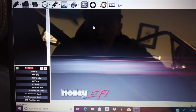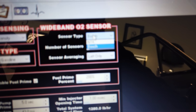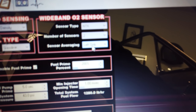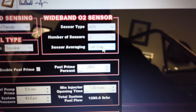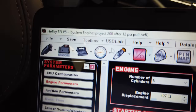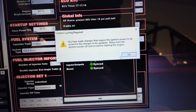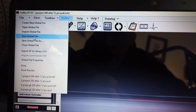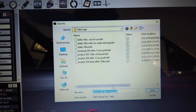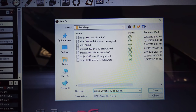So I went ahead and downloaded the tune from the car. I'm going to go over here to configuration — select Bosch, put it to NTK 2. I'm going to go ahead and leave it on left only for right now until we see what the right bank is doing. I ended up going to left only because that other sensor was fighting us for sure. Going into USB — as you can see the system changed. Send to ECU, and then we have to cycle the ignition. I'll probably reread from it to verify it took the change, and then save it — save file as — and put NTK, so we know which one it is. I'm probably going to move all the Bosch tunes to their own folder so we don't accidentally write the wrong tune.